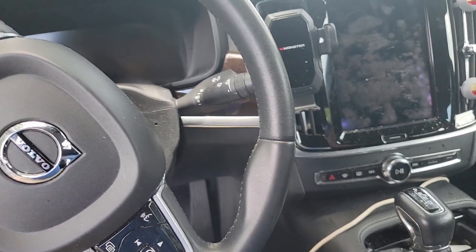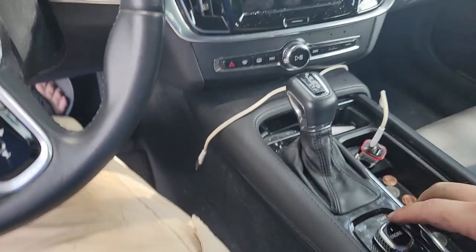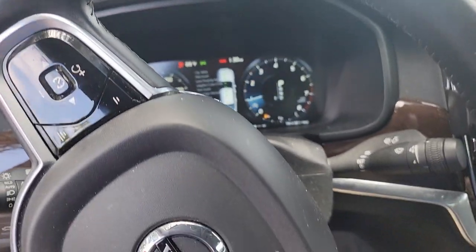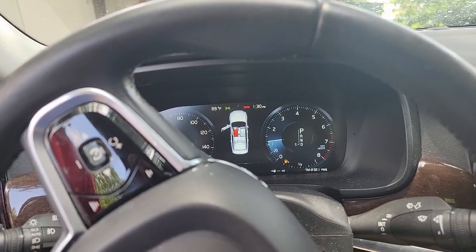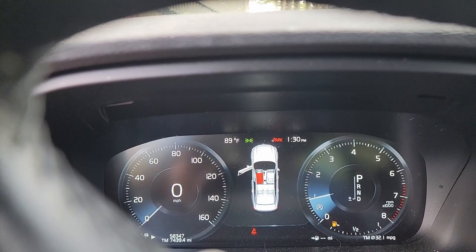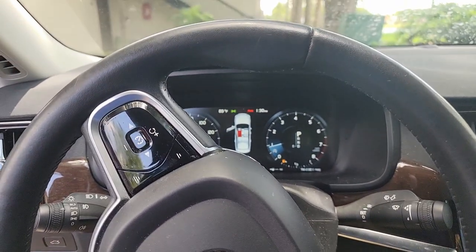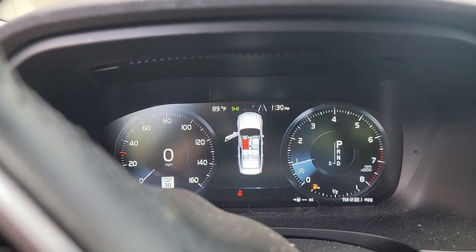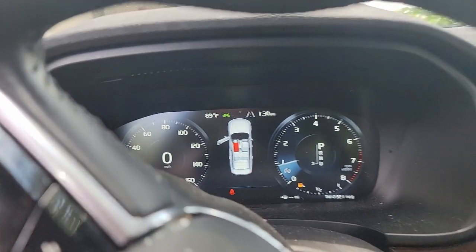Since we had to take the electronic brake motors off, we have to recalibrate. Put on the brake, hold the parking brake up, and start the car — then keep holding it. Still holding it. So we should be good — drop it off, then tap it one time to turn the park brake off. It's making a liar out of me — there it goes, and we're good. We're just going to hold it for a second and make sure we don't get any warnings, because earlier it popped up and said park brake not fully disengaged and threw an error code. But we're good. Thank you for watching.